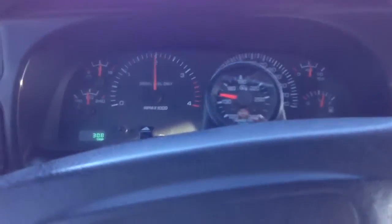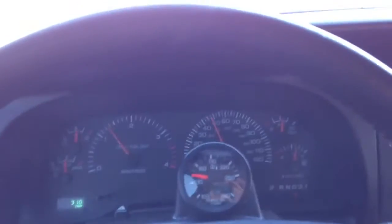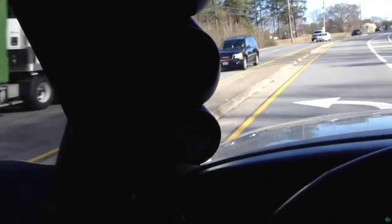The temps I see on here — usually cruising around I'm getting like 150 on this gauge, it's still warming up a little bit. But on highway I get around 170 on the trans temp. Then on the pyrometer, speeding up I get around 700 during acceleration, and if I'm cruising at like 60 miles an hour I get about 600. I haven't tried wide open throttle yet because my transmission only has like 200 miles on it, so I'm still breaking that in.